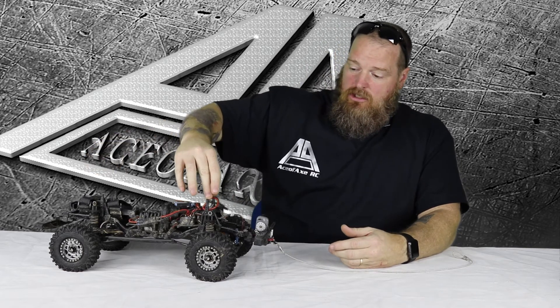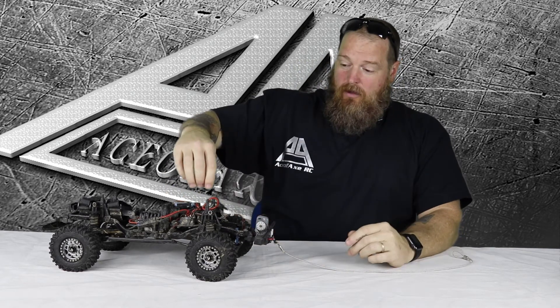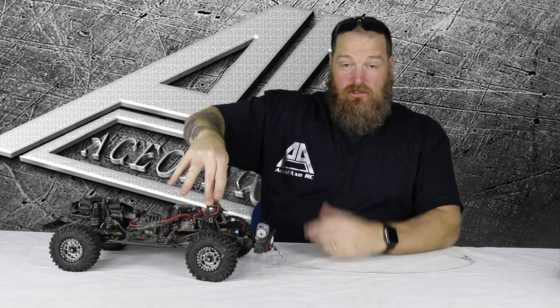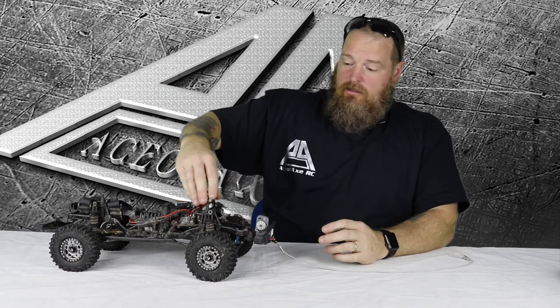Another thing I want to hit on is the shock towers. A lot of people are putting braces in here and that's cool, but I don't do it and I'll tell you why. These are opinions only — y'all do what you want, it's your rig. But for me, the holes in the body shell are already cut exactly where the factory marked them on this clear shell, and when you put that on it puts the shock towers out exactly where they're supposed to be. That's just as good to me as any kind of brace. Once those go out like that it works fine. If you feel the need to stiffen yours up that way go ahead, but I'm just using the body to hold those out — everybody thinks they fall in, but as soon as you get the body on they go back to wherever you got the holes in the body.